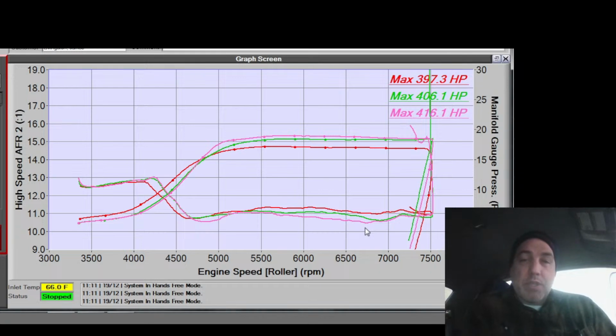That intake valve gets really hot, the port's really hot, and so shooting at the back of the valve actually makes it atomize more, and it puts it down there at the bottom. And then during overlap, when some exhaust gets pushed into the intake, that heat hits the fuel too, and it helps it atomize even more. So early injection timing on a running warm engine is beneficial, but on a cold engine, I don't think it's beneficial. So being able to change your injection timing based on coolant temp would be pretty cool.